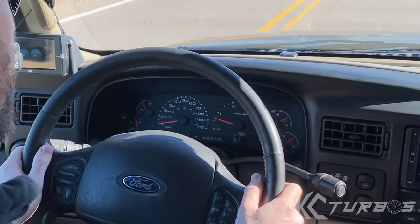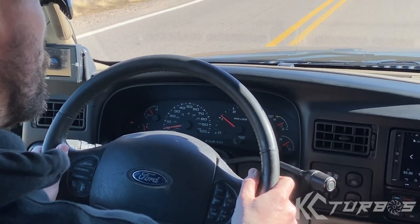What you want to do is slowly roll into it — bring your RPMs up, bring your boost up, and bring your EGTs up — while you're just barely smoking out the tailpipe. You don't want big thick black smoke. When you get up to the optimum boost and RPM level, then you let off the brake and floor it. And that's how you do a boosted launch.